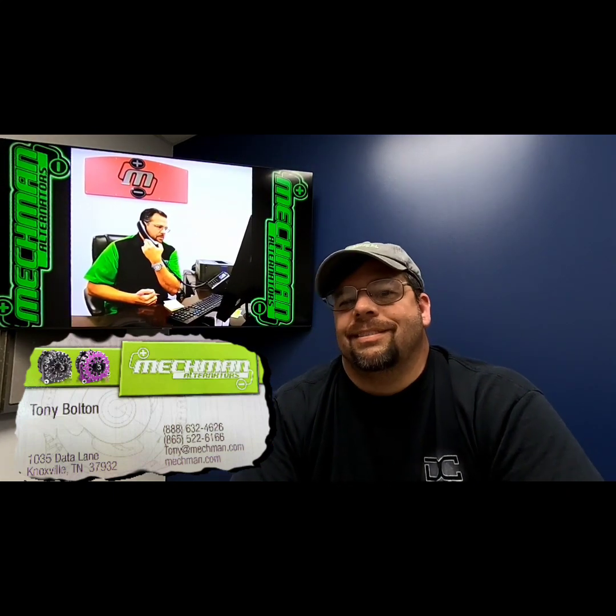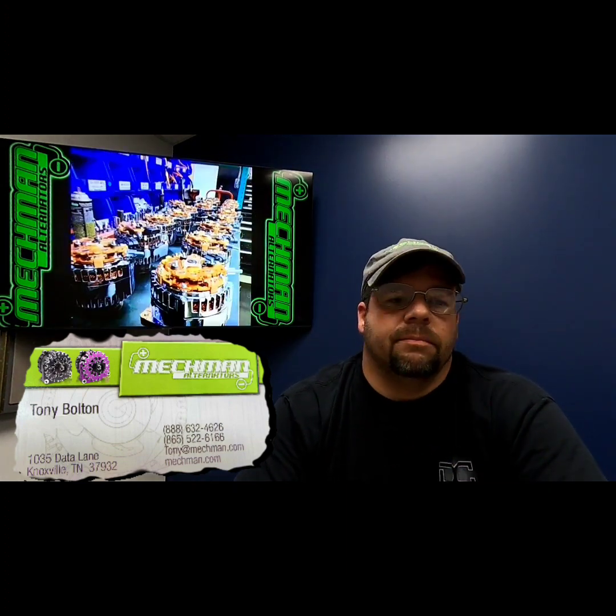The best one is I was sent a video where the alternator was literally laying on the concrete floor with jumper cables on it, and I was told it was not turning on. Rewind that. The alternator is sitting on a concrete floor. The pulley's not turning, but you have power going to it. You have 12 volts at the power stud, and you're grounding it on the case with a set of jumper cables, and the pulley's not turning. And you're calling us, telling us the alternator doesn't work right out of the box. So that probably ranks up there as one of the king instances. You just have to troubleshoot that and move on. Kind of obvious how we fix that.